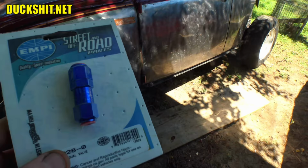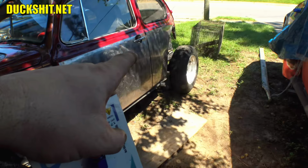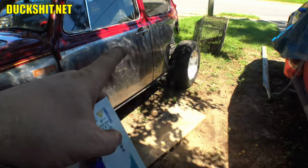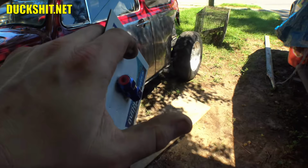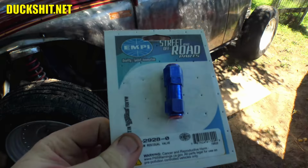This will eliminate that. Also, the brake problems that we fixed in the back, seeing as how that one had all kinds of long travel on it because it was all out of alignment and it was all bent up. So he had to double pump it to make the pads move into position because the caliper was all messed up. All that pumping would eventually make the caliper move on the plate it's mounted on, which is just ridiculous that this was even having to happen, but that's what made it work. And then of course when you let go, everything moves back and all that fluid comes back, so you have to double pump it, or even triple pump, he said sometimes. This, again, should solve that, plus what we fixed in the back.